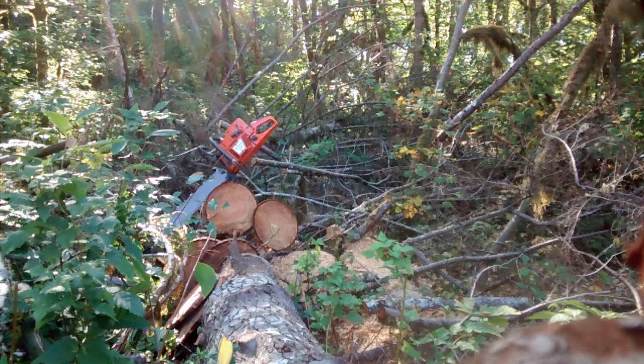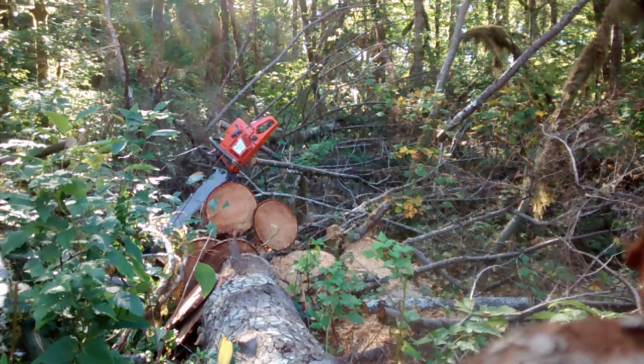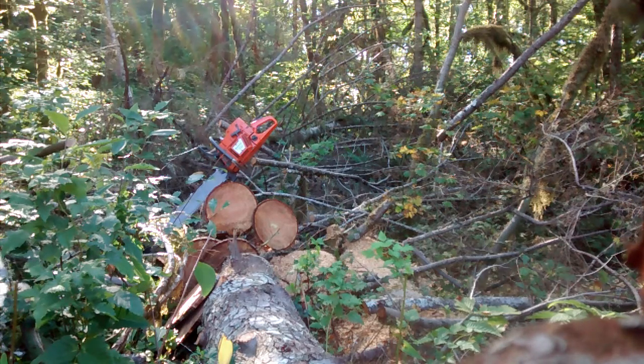If you're good at tuning saws, you can listen to them, and you can tell when they're four stroke and tell when they're not. It just takes a good ear and being able to do it a lot. I'm not the greatest at it, but I can get them tuned in pretty good. If you're going to do it, you need a good tach and everything. That tach I got's not the greatest. There's some better ones, but that was what I got, a little bit cheaper, and it works pretty good.